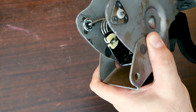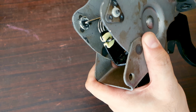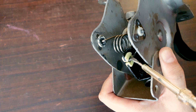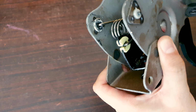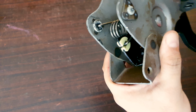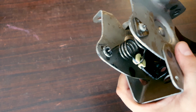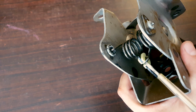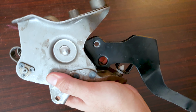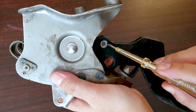There's still a little bit of movement, but I believe this is less compared to the previous one. As I compared the bushing, the gap is less. So the spring still does move. I guess that is by design, but I'm hopeful this will solve the creaking issue now. I will grease these bushings up more, and where the pin goes, I'll grease this area up too.